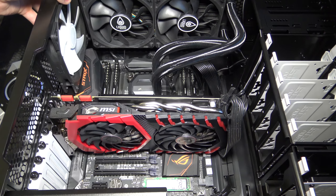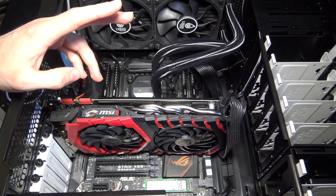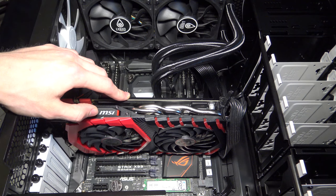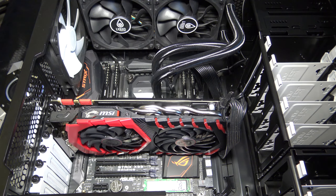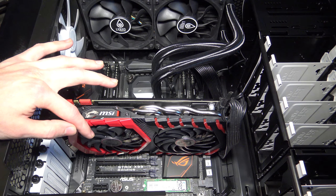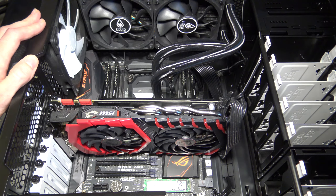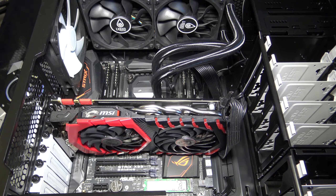Even in a quite large mid-tower, if you install this card you can pretty much only SLI two-way, since the second card would need to go in the third PCIe slot. Maybe if I moved the power supply I could fit a third, but I doubt it. This is an X99 system — an Asus Strix X99 Gaming, a Broadwell-E motherboard that supports four-way SLI — but not with a cooler this size. If you found this helpful, leave a comment, subscribe, and like the video.